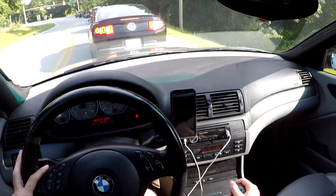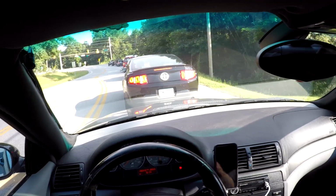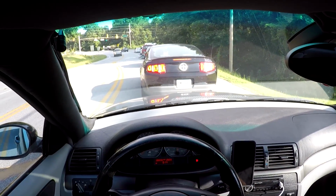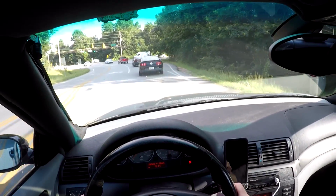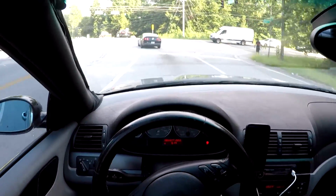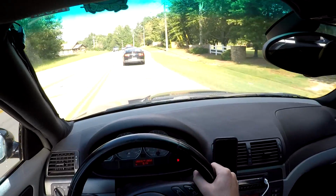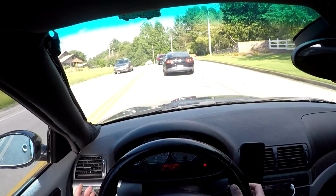And with this car, I'm not gonna do anything super crazy, like a super loud exhaust. The exhaust as it is right now is just loud enough to be perfect, and I don't want to go any louder than that. Same with the brakes. It will have aggressive enough for just normal street use, but nothing out of this world. It's not gonna have endurance racing brakes or anything like that. And if I do decide to do a track day in this car, I may change out the pads. If I've got W2s on it for the street, I may change it out for W5s for the track.